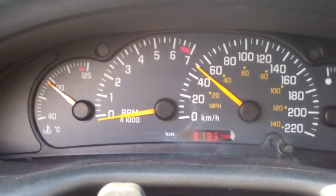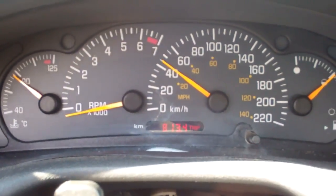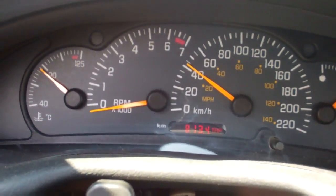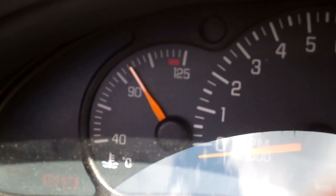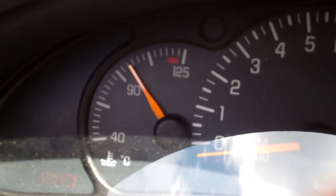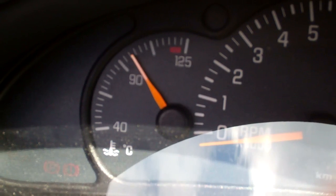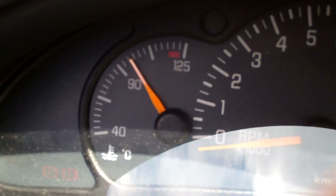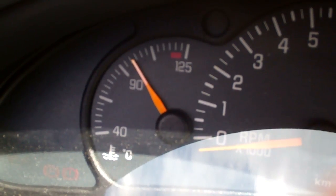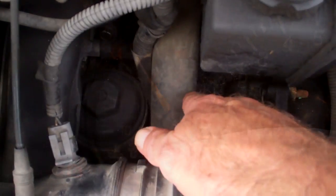I'm just driving slowly through town and we can see our temperature gauge is already starting to go down substantially. That's a very common symptom of a fan that's not operating — it overheats when you're idling or driving slowly, and cools down as soon as you start to move. I pulled off the highway and now, without air rushing over the engine, this engine is starting to heat up real quick — it's well over the halfway mark temperature-wise. Something should be kicking in to cool that, whether it be the fan blowing air through the radiator. We're going to pop the hood and have a little peek.